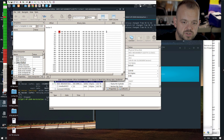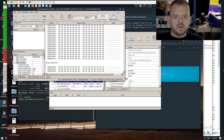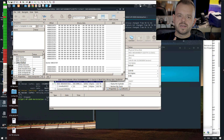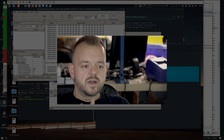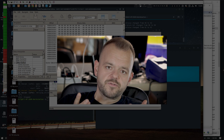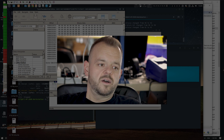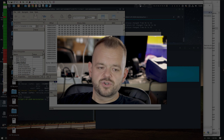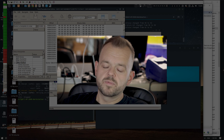Even with zeros the data is gone — there's nothing recoverable. For SSDs it's the same idea. There's some fear-mongering about SSD secure erase leaving some data behind — it's theoretically possible but highly unlikely and no one's going to those extents. With traditional hard drives, if you have bad sectors that have been moved to the G-list, you might find some data there, but what could really be in a few sectors? Your average Joe is not going to find anything.